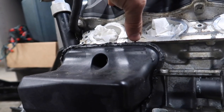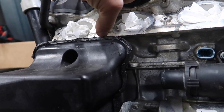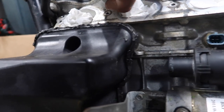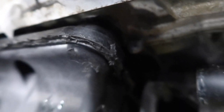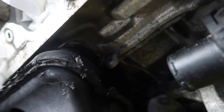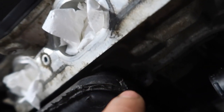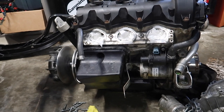These tanks leak because it's a two-piece tank, as you can see on all these seams — glued together. Just to be safe, I put a layer of silicone all the way around it, so even if the Ski-Doo seam leaked, my glue would be behind it. There are o-rings back in there — this is supposed to slide into the block and seal. But Ski-Doo's tolerances are off, so they always leak. You need to put putty on the o-ring, then shove the tank into the block to get a solid seal.